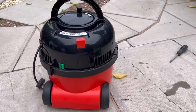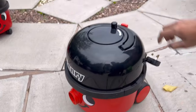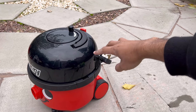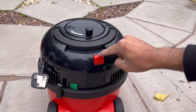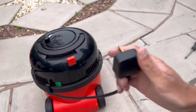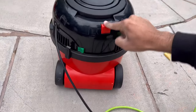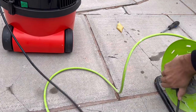It's in marvelous condition — I've just given it a bit of a clean up with some wipes and it's looking quite nice. Originally I thought the cable was the issue and the capacitor inside the cable rewind, but I fixed that and it's still not working. I've discovered it's actually the switch — it clicks on and off but it's a bit iffy. I've taken the switch apart twice and ordered a new one. On low or high it doesn't work, so it's definitely the switch; the motor itself is fine.